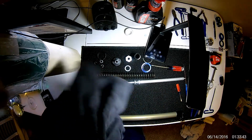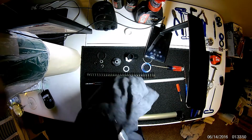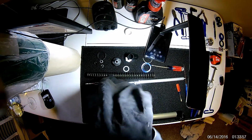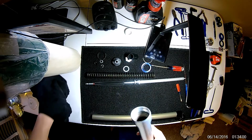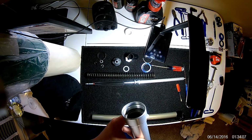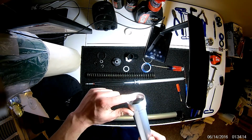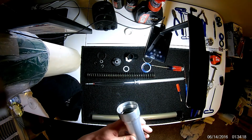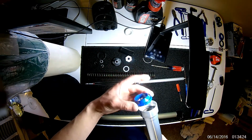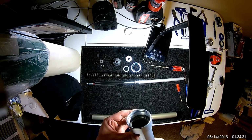You can see kind of the inside of the fork tube here. I'll wipe it down. See, there's all kinds of crud in there. Old fork oil and dirt, grease maybe. Okay, so right there you can see the inside. There's a little bit of damage right there. I don't think that was from me. These forks had been rebuilt in the past, but the damage, and it's not much damage, I'm probably exaggerating it, looks like it is above the seal. It's into your outer dust cover here. So nothing to worry about there. Everything else looks really good. So yeah, I'd call that a success.